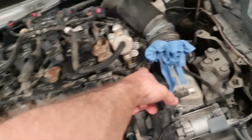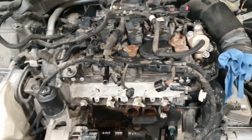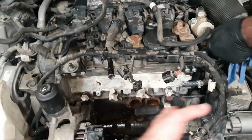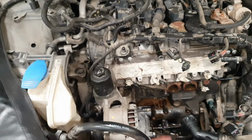All right, we block also the high pressure pump, just in case, don't blow anything here. And find some good caps to have a good grip. So later on if we make a... Okay, we're gonna block everything. We're gonna cover all the pipes. And also here the oil dipstick, to not contaminate the engine.